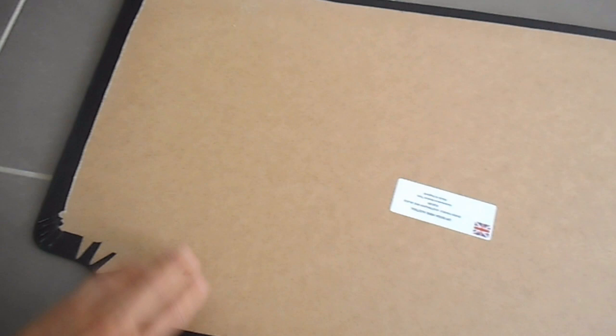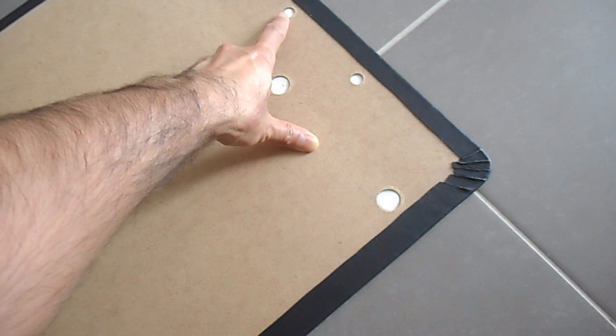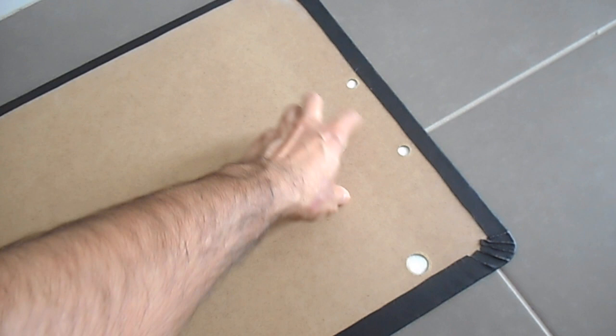The other things it's got are the actual door cards — so they're for the front doors, and these are for the rear panels. The actual vinyl has a lot of sponge underneath and it looks like they used some sort of heat press to get these lines into it. On the other side you can see the masonite board. The edges have adhesive sprayed on and are pressed down. These come with holes for the door opener and the window winder. There are other holes that need some sort of clip — I've got to investigate what I need for those. They go into holes on the body. There's a little metal bar inside the door pocket that I think might hold the rest of it in.